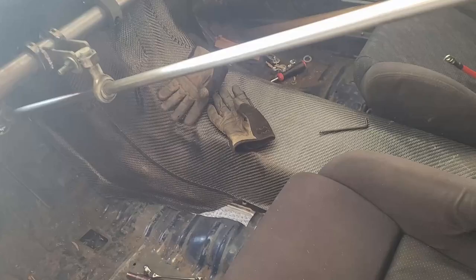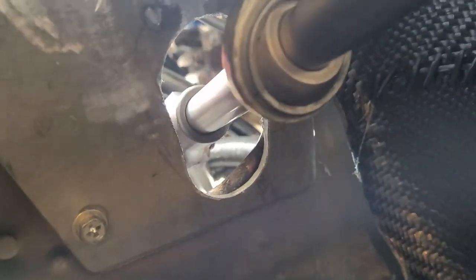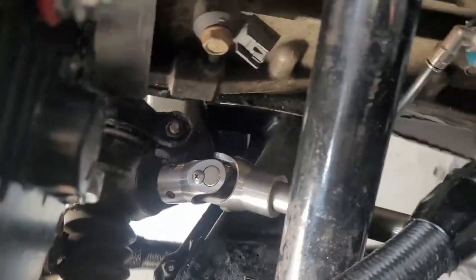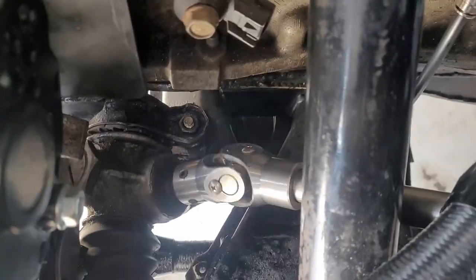Alright, so it's been a few hours of trial and error. We got this where we want it — going in at a much higher profile, and with our new support and pass-through everything moves freely. This isn't even tacked yet, it's just pressed in there, and the U-joint still spins free. There's adequate clearance to the frame rails, and you can actually move the wheel. Now all we really have to do is figure out where we want the wheel and cut the shaft to length — I'll probably cut it on the far side because you can always add spacers to get it closer if you want.